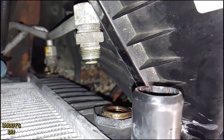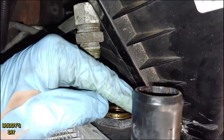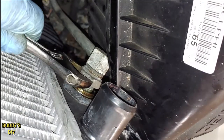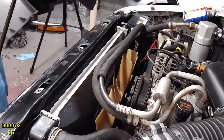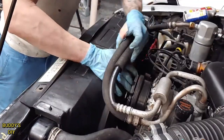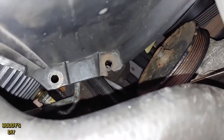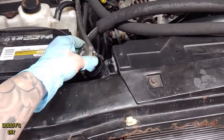Now move over to the left side. Same thing — start with the bottom hose, work your way up to the next one, then hook up your coolant hose and the top line. Take your fan cover and put it back on. Be careful when bending the AC lines — we just did AC work so we don't want to create any leaks. Secure the fan cover with the three 10mm bolts, plus two more bolts securing the bottom of the fan cover on both sides. Last thing to do is fill up your radiator and put your cap back on.